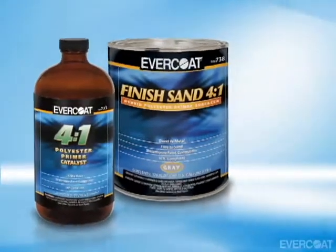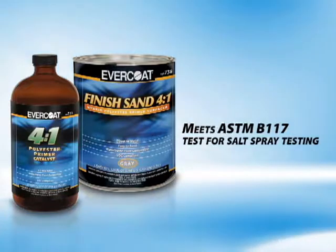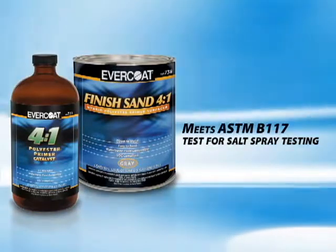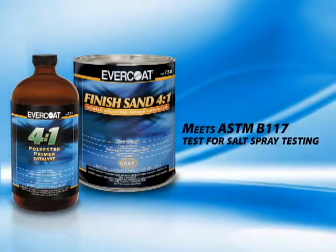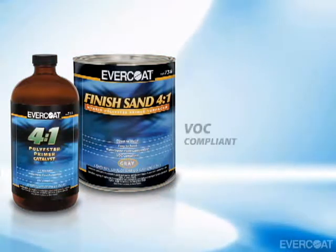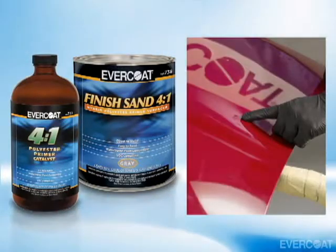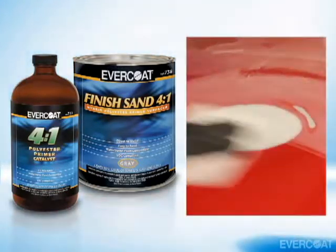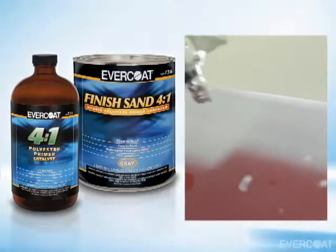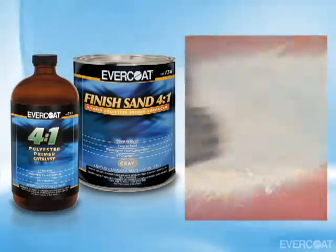Finish Sand 4:1 passes 500 hours in salt spray tests, ASTM B117, and can be applied over properly sanded and cleaned bare metal. It is compatible with waterborne paint systems and is VOC compliant. This video will cover the approved substrates, recommended cleaning procedures, application recommendations, mixing, and finishing techniques.